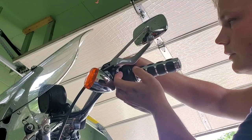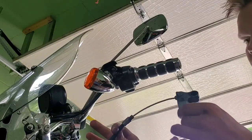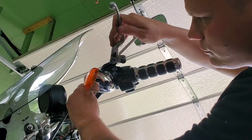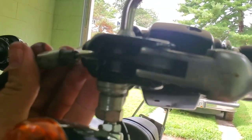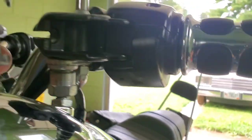With the slack you've created, you should be able to pull the cable end right out. Then you'd pull back on this part to get the cable through that slot while you pull your shift lever out and around. This part of the shift cable fits right in the back here. With your shift lever and cable out, you'll see a white piece — that's actually a bushing that holds your cable to your lever. The end piece just slides in and the bushing goes in between them, holding it in place.